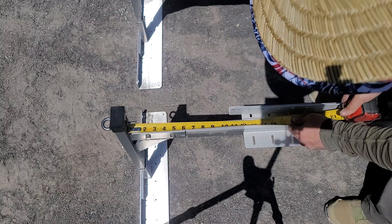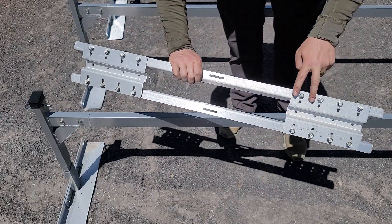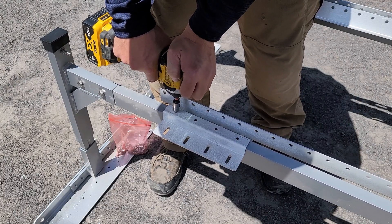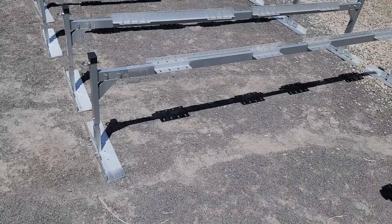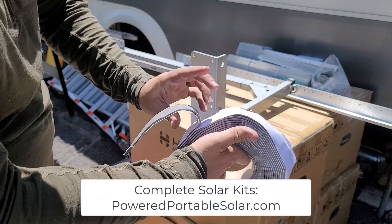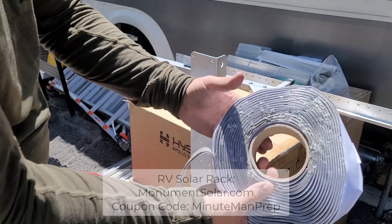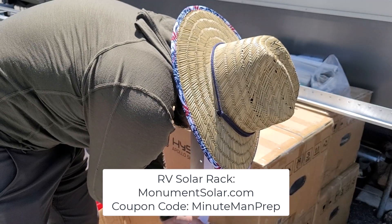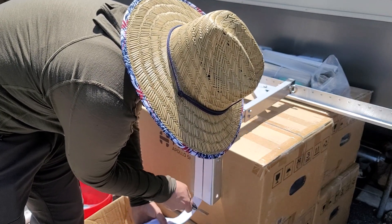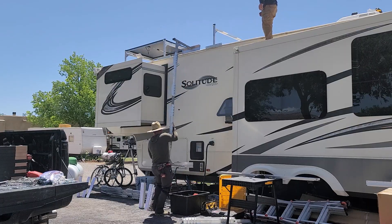You'll want to follow the instructions from the manufacturer on how to get these saddles properly. We have our saddle and two lower swing arms, four bolts on each side, and in our case we're right at about 11 and a half inches from the post. Now these are almost ready to go up on the roof — there's only one last thing we need to do: butyl tape. You peel right from here — don't stretch it, and keep the paper in place. With this butyl tape we ended up using quite a bit of it. The real goal is to cover each hole underneath the bottom of the base plate so there is no chance of water intrusion. We're also going to be putting Dicor lap sealant on top of this. I highly recommend using a box cutter or really sharp knife — it will get dirty, so use something disposable.